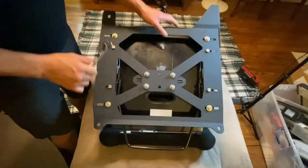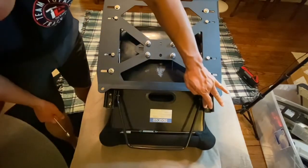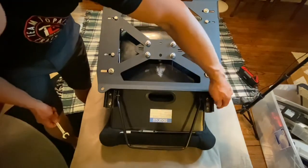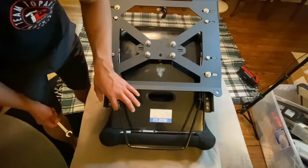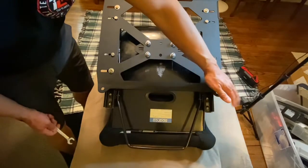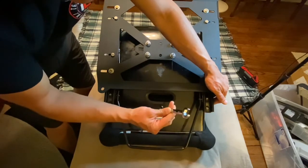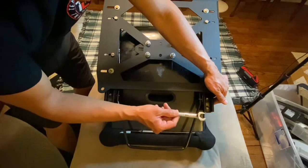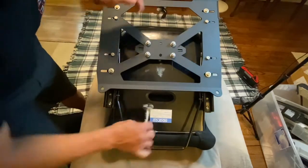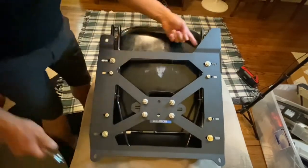Now we need to lock down the bolts that are holding the slider assembly and the side mounts together. But before you lock those things down, you want to make sure that you take the spacers and align them right here and right here. Obviously, if you don't have the spacers, this is not a problem. It's already aligned. And all you're doing is locking these 4 nuts down, and that's using a 13mm open-end wrench. So you have 1, 2, 3, 4. You'd reach here, here, here, and here. And then you have to do that again on the opposite side, over on the back side over here.